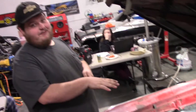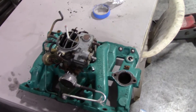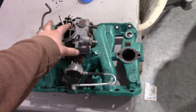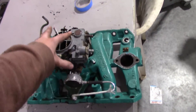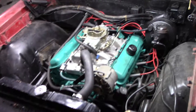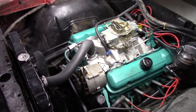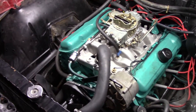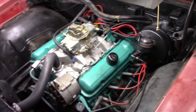What do you think Justin? It's a different animal now for sure — big time. First 326 I've ever been behind and it runs good with a four-barrel. We'll check out this two-barrel intake over here — this is what it had in it, and it was a sick puppy. It just didn't always make it up the driveway. I definitely think the carb was having several issues, and me and Jesse were talking — why do we want to put a two-barrel back in it when we can slap a four on it? This swap really turned out clean and it made the motor look a whole lot better.